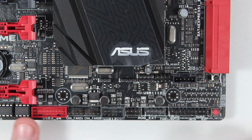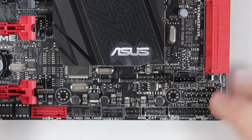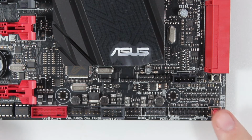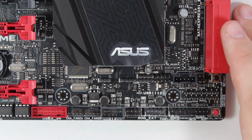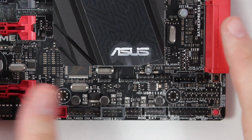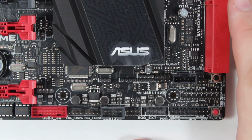Right here at the bottom left, you can see the two BIOS connectors. Basically what Asus did here was that they did not solder these on, so if something went catastrophically wrong and they were both dead or one of them died, you want to replace it, they can send you a replacement one of these, and you can pull that one out and pop a new one in should you need to. But again, it's a standard thing here because you can see the BIOS switch button again, so you can switch. You can have separate versions of the UEFI, and you can BIOS flash them with the USB and stuff. It's an extreme case that the two of them fail, but just in case they didn't solder them on for that exact reason.